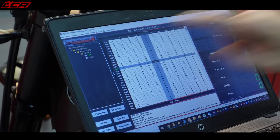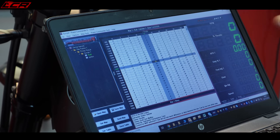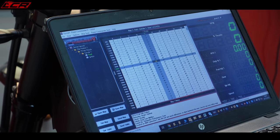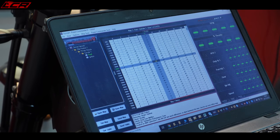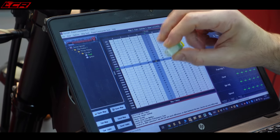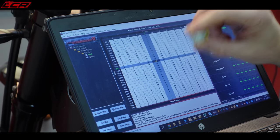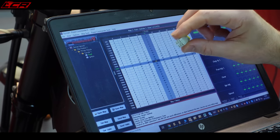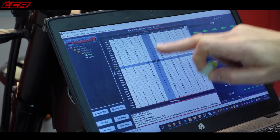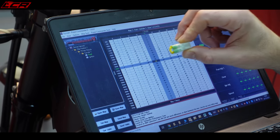This is in this area. So if you're adding a power commander, make sure you've got the dongle to buy. Let me show you the dongle. This is the dongle you need to plug into the lambda connector on the bike. It's got a couple of little resistors in there. It just takes away the closed loop fueling, basically, so you can get correct fueling at the bottom end. And that'll really make the bike feel much nicer at the lower end of the rev range.